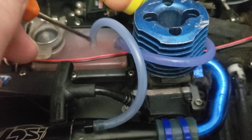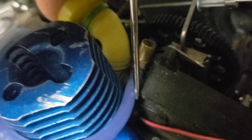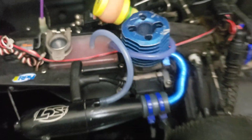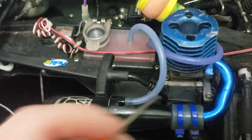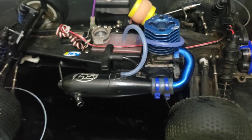If this tank leaks, or you have a leak here, or on an engine like this, or your high-speed needle is really loose — turns super easy with almost no effort — or that banjo fitting is missing its washers and it's loose, it will cause all sorts of problems. You can't have any kind of leak because you need exhaust pressure to build fuel pressure. If you have any leaks it's never going to run right, won't start good, and it'll always tune bad.